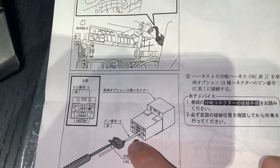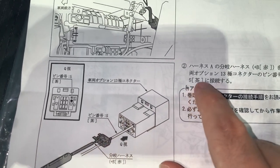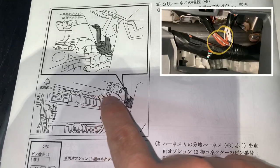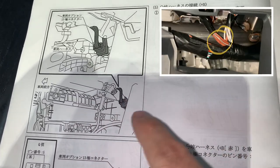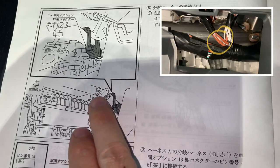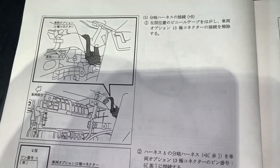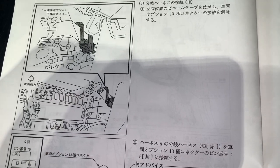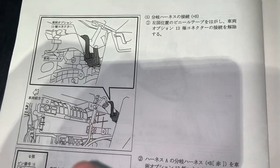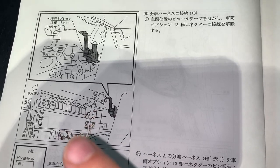The translation of this character is 'brown,' so I was looking for a brown wire. There are several brown wires up there — a harness comes through but it's all wrapped and sealed, and there are quite a few cables in a couple of bundles that go up over the reinforcement bar and terminate on a grounding plate connected to the bare metal of the car chassis. So all of the brown wires I traced up there were all grounds — definitely not a positive. Even if I tapped into one of them, the system wouldn't have worked.